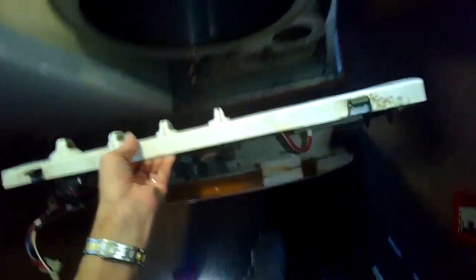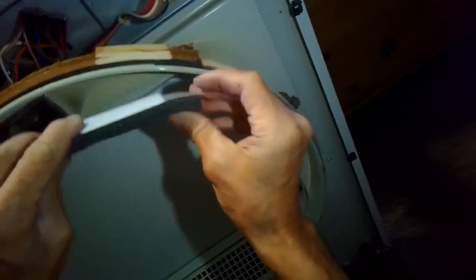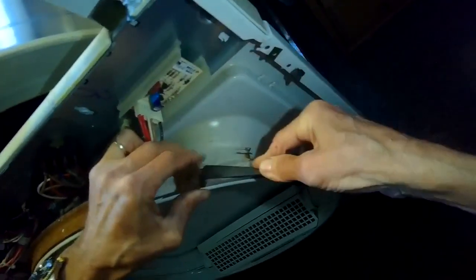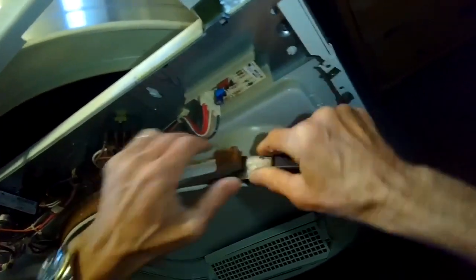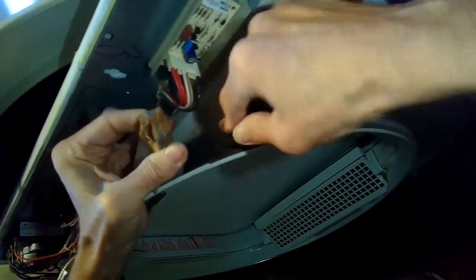This front panel is where the front bearing lives. We're going to remove the old one by scraping it off and then putting the new one on with some contact cement. Here's the new one, and there's the old one — that rusty-looking color is where you get brown marks on your clothing from the front bearing being worn out. I'm just using a paint scraper; a standard flathead screwdriver would work too. Work it underneath the old bearing and wiggle it off to break the old glue connection, since they're glued on at the factory with contact cement.